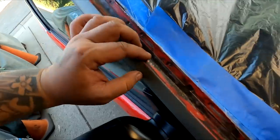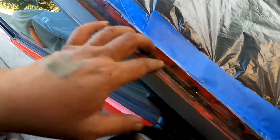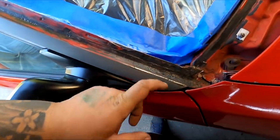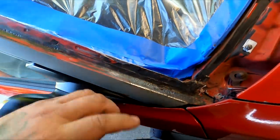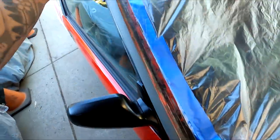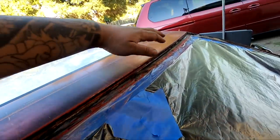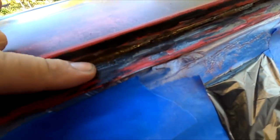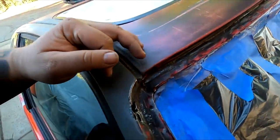This whole section right here I'm going to cut it out, same deal, and patch this up the same as the other side. You can see right here it's pretty chewed out — so cut a little square section, put another piece in there. All of this is just eating metal but not all the way through, so all of that just needs to be treated. Down here I'm surprised it didn't eat through. I'm just going to tack some of these little pinholes in and then treat all of that and prep it for paint. The whole top section right here is almost clean — there are some rust spots on the surface but not all the way through, so that's good.